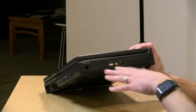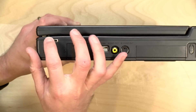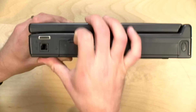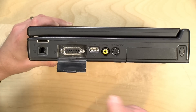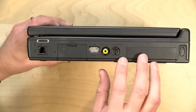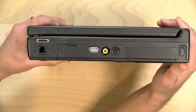There was a ton of connectivity on this beyond the modular design. On the right-hand side, you had a little port for connecting a mobile phone — I remember doing this with my Motorola phone back then. It also had a built-in modem that was software upgradable to 56k, starting at 33.6. There was a game port adapter here for connecting PC game controllers, which also worked as a MIDI controller. And then a new feature was a USB port — this was one of the first machines with USB, as it was a new technology back then. There was also analog composite and S-Video out.